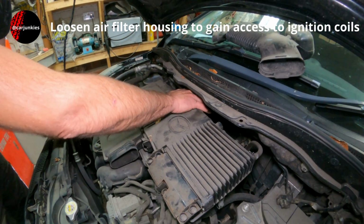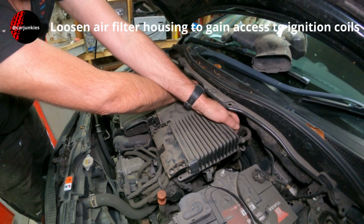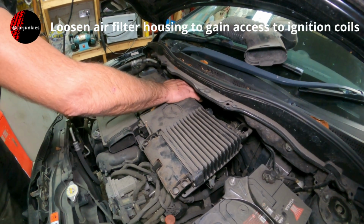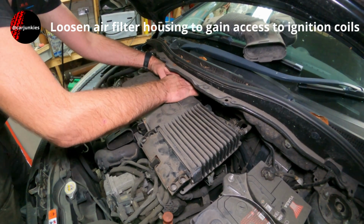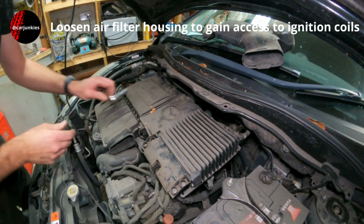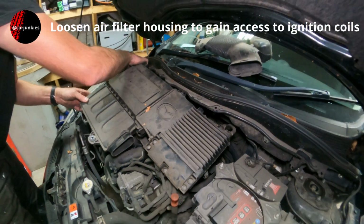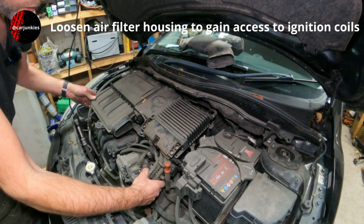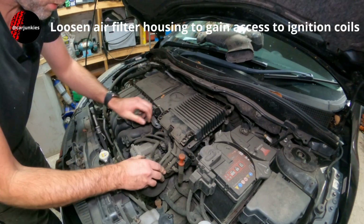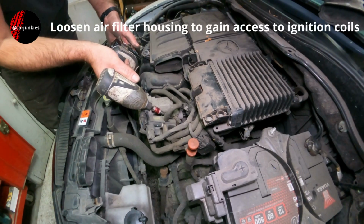So you can see there are various smaller pipes, cables and things that are attached. I'll just unclip that from the back. Hopefully there's enough give on them just to lean it up out of the way so I won't have to disconnect everything. Right, yeah, another 10mm bolt. Oh yeah, that's a lot looser now. I think actually I'll undo it down there from the throttle body.